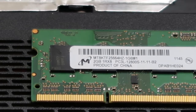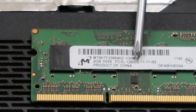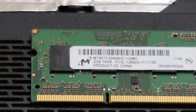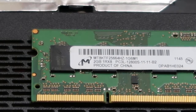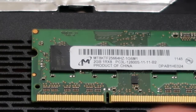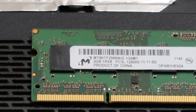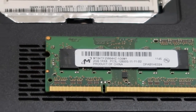The other number you need to order RAM is right here: PC3L-12800S. That's the other set of numbers you need to order the correct RAM. So if you find out that this RAM stick is bad, you go on eBay, put in 2 gigabytes or 4 gigabytes if you want to upgrade, and then put in PC3L-12800S — that'll give you the correct RAM stick. That PC3 is another way of saying DDR3. Often times you'll hear that this computer uses DDR3 RAM or DDR2 RAM — the PC3 or DDR3 label is how you would know.